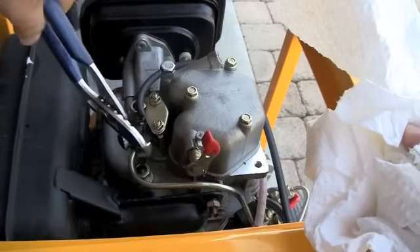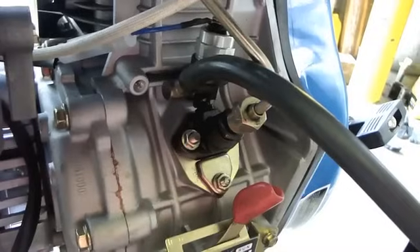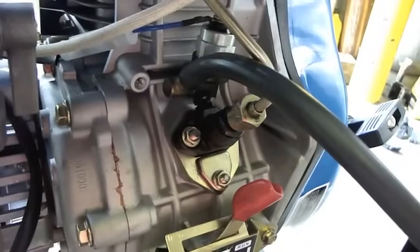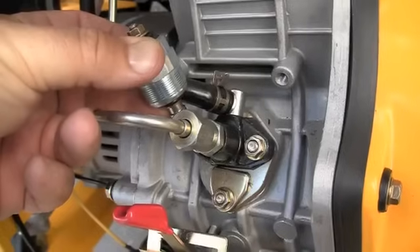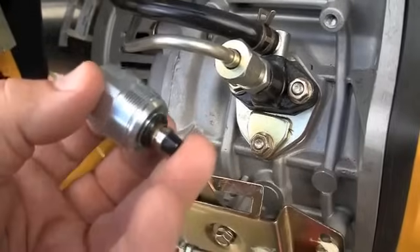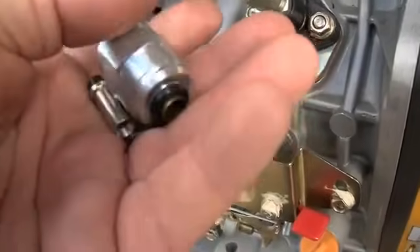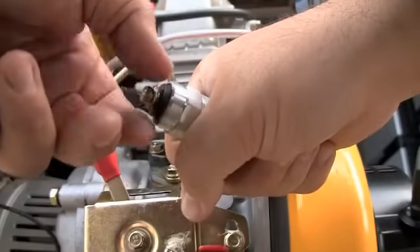Some generators have an electric switch on the fuel pump used to shut off the fuel supply with a remote control to turn off your generator. It has a fuse, and the blue line goes to the top of another component which is your magnetic fuel switch. It had a blue wire and a fuse that you should check. If the magnet doesn't work you will have no fuel going to your fuel pump and then no fuel coming out of your high pressure fuel lines.